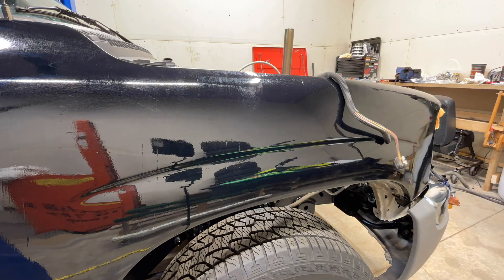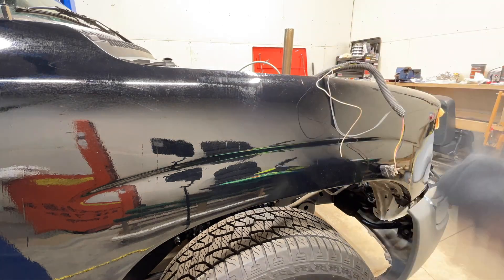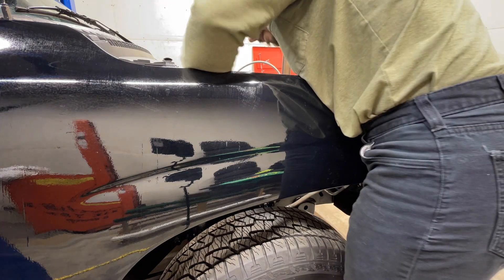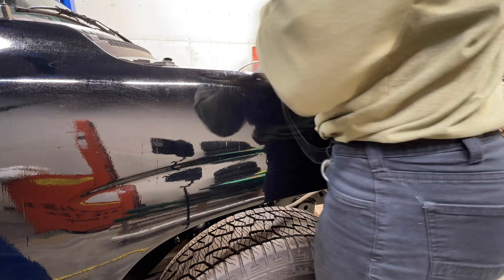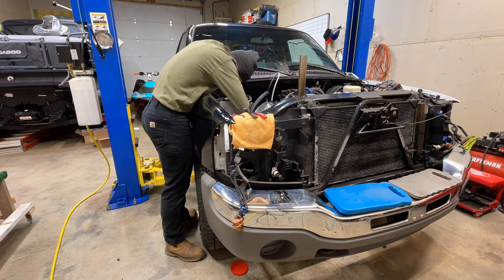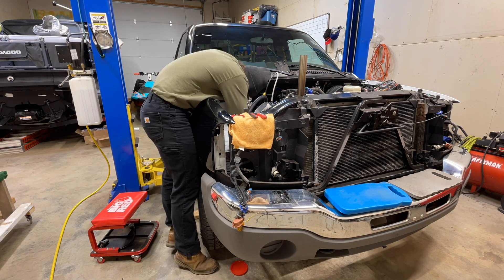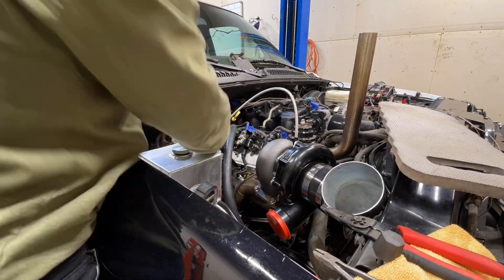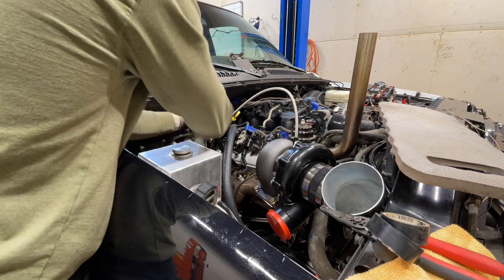In this time-lapse section, I'm taking the original mass airflow sensor connection plug and starting to de-loom the harness. I pulled the black and white wire and the tan wire and cut those out of the connector. Then I started taking the wire loom and electrical tape holding it all together out, and took it back to the center of the engine harness. After getting it de-loomed back to where I wanted it, I put the harness back together using electrical tape and the original wire loom to maintain that OEM-ish look. I still have the leftover pink, yellow, and black wire from the connector — I'm just going to tie that up.